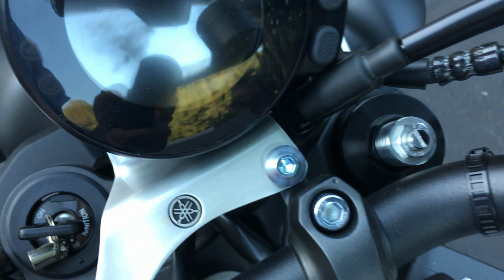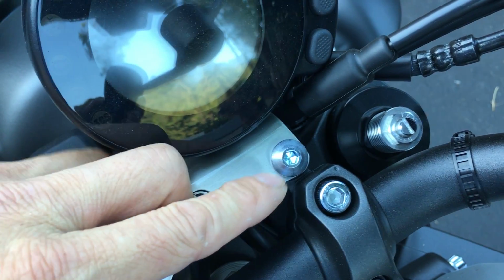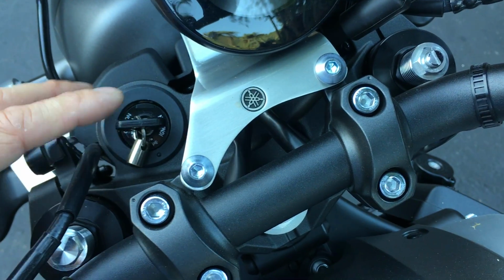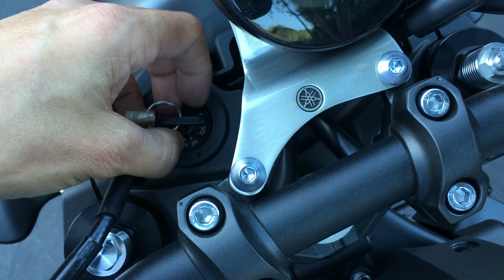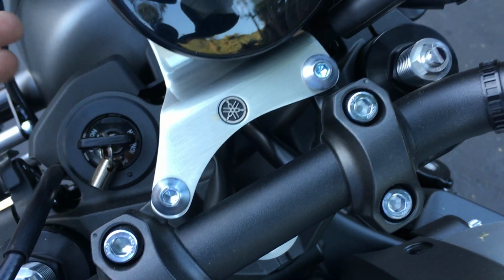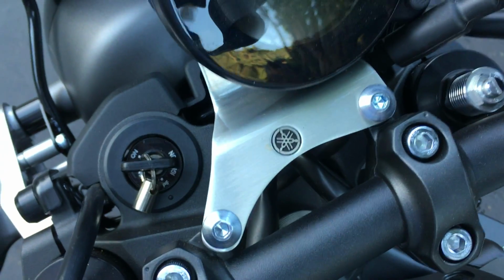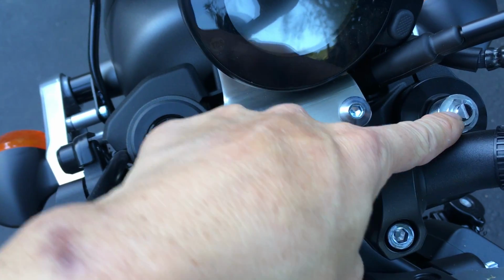You have to ride a lot of varied conditions just to see what it feels like, and it takes several hundred miles to get this dialed in properly. But at the same time, this bike's still pretty new. It only has like 650 miles or so, so the springs are not broken in yet. The springs don't usually fully break in until about 3,000+ miles, depending on how heavy you are and how aggressively you ride. When you're more aggressive or heavier, it breaks in a little sooner versus lighter, less aggressive riders. I'm real light, and the first 600 miles I was taking it really easy to break in the engine, so I haven't been riding that hard. As the miles add up, I will ride harder, and I'll have to come back to this and readjust it.